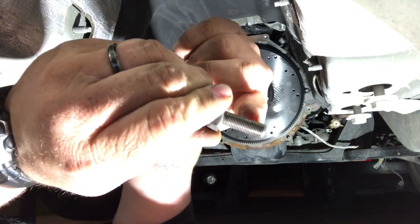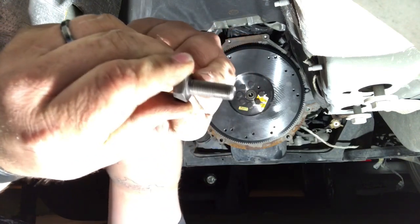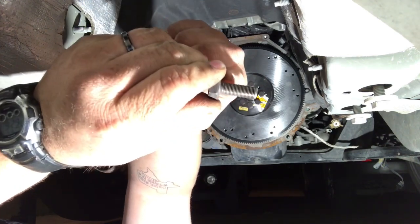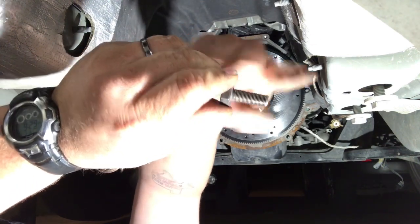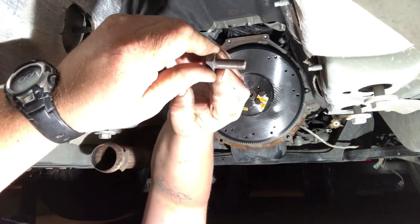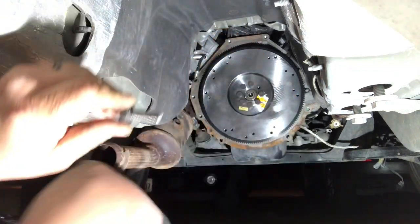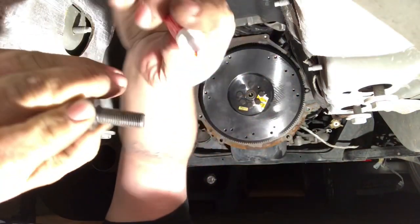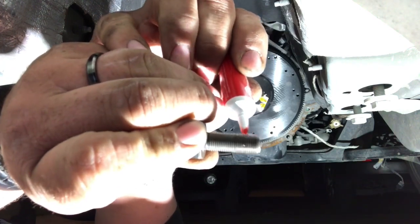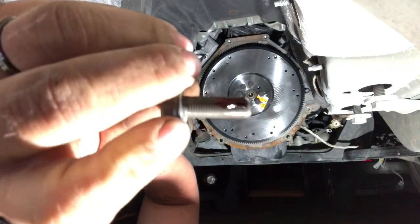When you put it up here, you thread it in, it's going to coat the whole bolt as far as it needs to. If you put it towards the end of the bolt, it's not gonna grab threads. Because you gotta think, you got flywheel or whatever else you're bolting down. So start your thread locker up here, like so. That's all it takes, just like that.